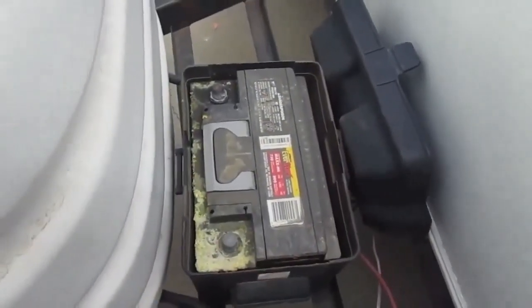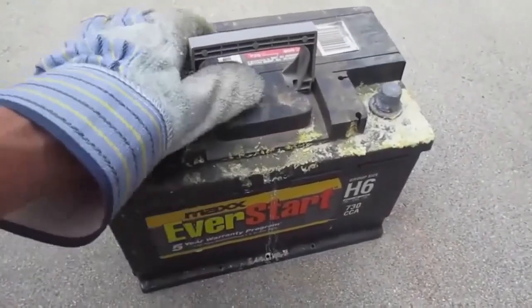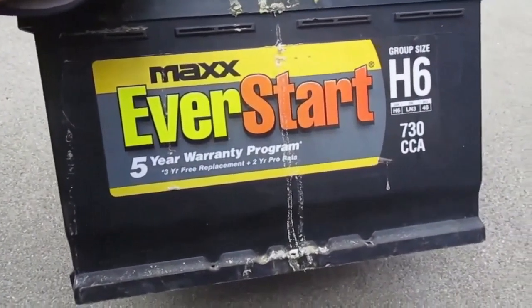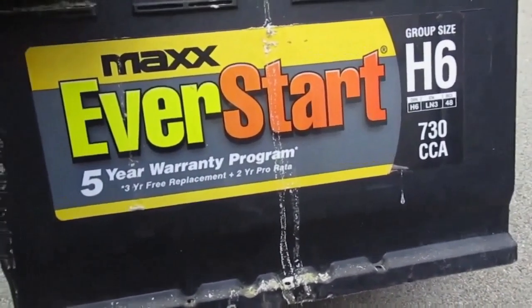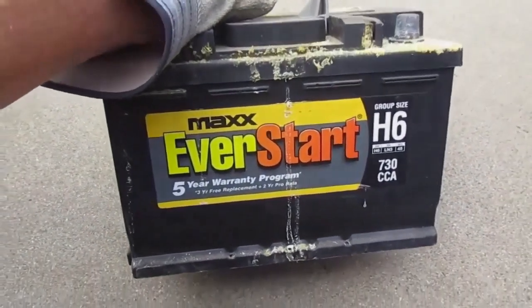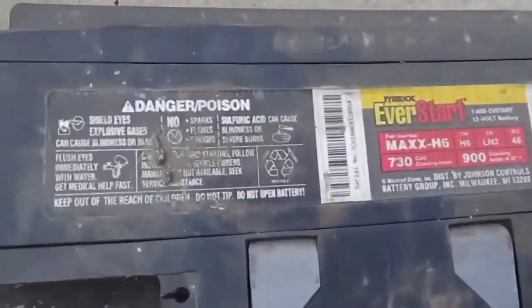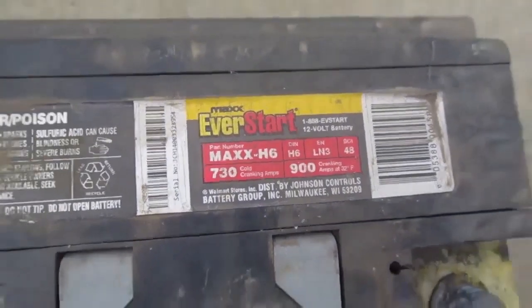I made sure to wear gloves before touching it — always do that when touching an old battery. You can see all you've got to do is look at the label: it's a starting battery, which is not what you want to use in an RV. You want to use what's called a deep cycle battery. Those of you who know RVs already know this, but some of you probably don't. If you see 'cold cranking amps' on the top of the battery, you've got the wrong battery in your RV.